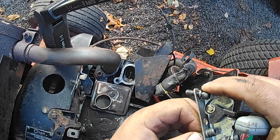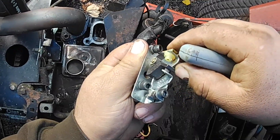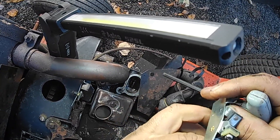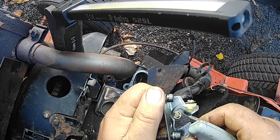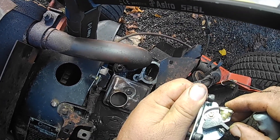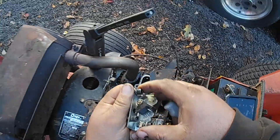The rest of the import points seem to hold up halfway decent. If you've got a good set of Repcos in your machine and the points aren't in bad shape, look in here and make sure they're not pitted on both sides. These ones aren't, but they're definitely dirty. If they're not pitted bad, you can take a small points file, some sandpaper, or emery cloth and clean these contacts up. Re-gap the points and they'll last forever. But we're going to replace them.